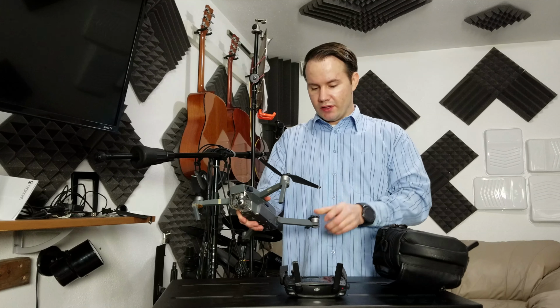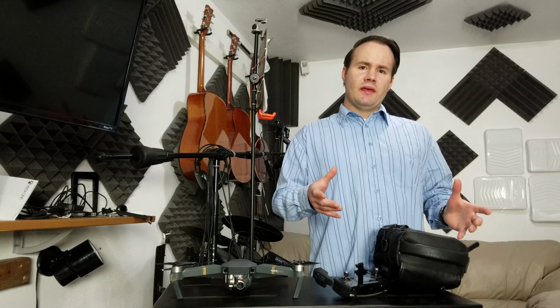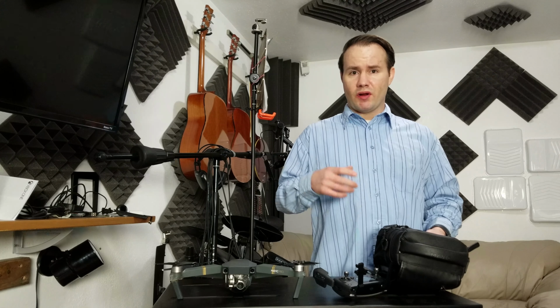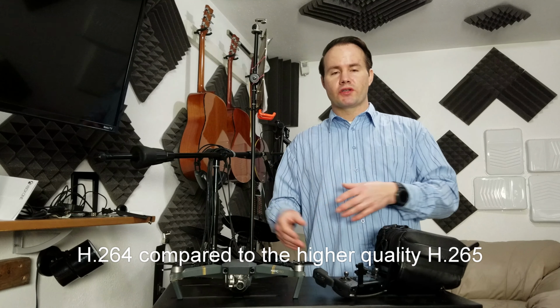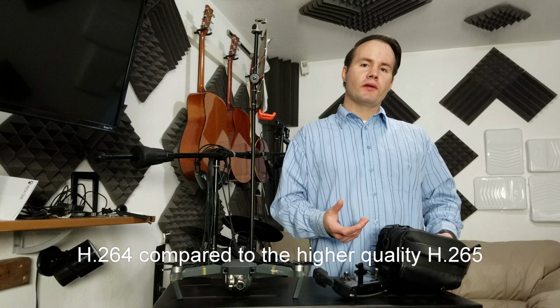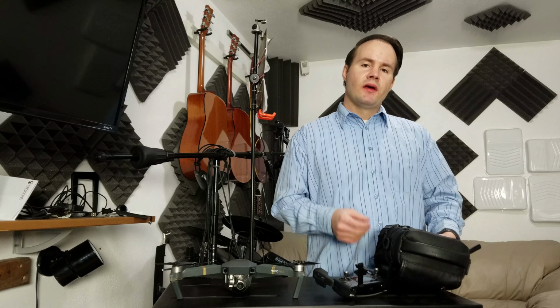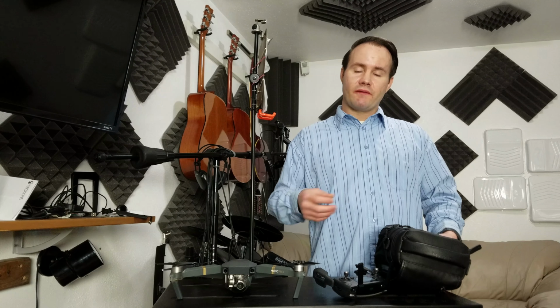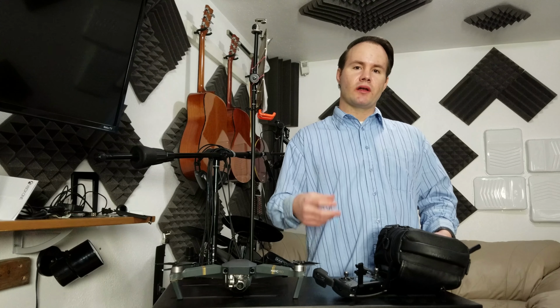I mean, a foldable drone that you could take with you with a semi-pro camera. A lot of users and people have been noticing that there is a huge exposure difference. The codec is overcompressing. It's because it's a smaller camera, smaller drone, and you're just really not getting the quality you would get from a professional model like the DJI Phantom 4 Pro, which we also have. There's also exposure issues with the lenses. They're either not letting enough light in or sometimes too much of the shutter speed. So you can actually put an ND filter on to fix that.